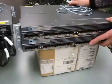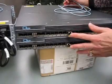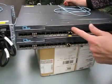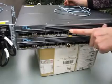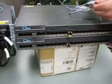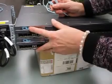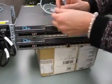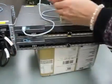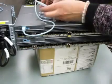One thing I wanted to point out is because some of these will be shipped to site already pre-configured, you need to install an SFP in the circuit interface. So if the circuit interface is port 12, which will be identified, then you need to have the appropriate SFP in place before powering up the stack. Another thing of note is Cisco no longer ships a console cable within each of the boxes, and the new console cable style is USB based. If you look closely at the front in the robin's egg blue, it's a mini USB connection. You can connect either the top or the bottom — it doesn't matter. This interface is a regular USB that plugs into any USB interface on a laptop or PC. So at this stage, we're ready to install our switch stack in your core.